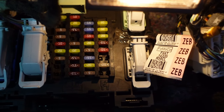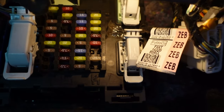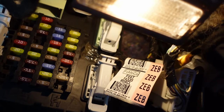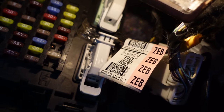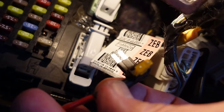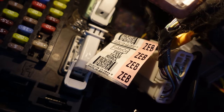I also want to find out which one of these is the hot side to make sure that I'm plugging the adapter in correctly. So we're going to turn the power on — of course something is not going to be powered — but we'll check and see which one of these prongs has the supply voltage on it, and it is this outer one. That means we're going to want to plug this in this direction so that we're feeding the power to the system through this fuse.